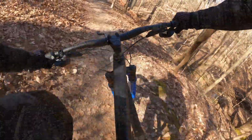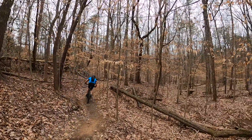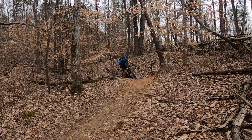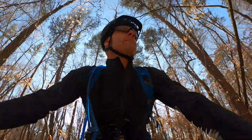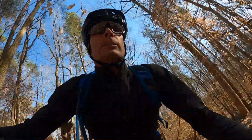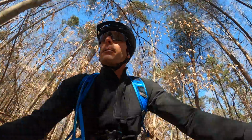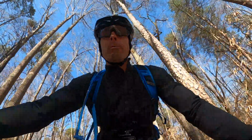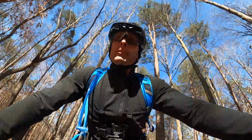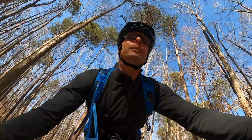It's pretty impressive. And of course, when you can make a chassis stiff, it's going to perform better because you're not ending up with a lot of friction on the stanchions from flex. So while we don't really have a way of measuring that here, I can tell you that it feels pretty smooth. And of course, I'm a big fan of anything that'll drop weight off my bike without sacrificing performance. So I'm digging this thing, and on the trail it does a remarkably good job of making the front end super feathery, super easy to lift up over stuff, but still plow through things, as you've seen, when you don't feel like lifting it up, which is nice. But sometimes you get lazy, and sometimes you need the fork to do a little bit of the work for you.